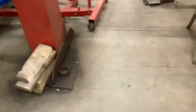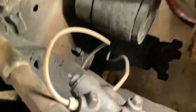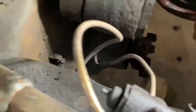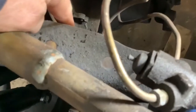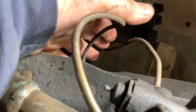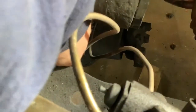As you can see, there's no plate in here at all. What I am going to do is I will be plating this section right here and this section in here. I'll be removing the brake line plastic clips — I have already moved the line out of the way — so when I put my plate in here down this way and run my mount part of the plate this way.